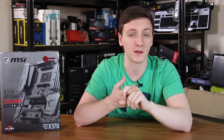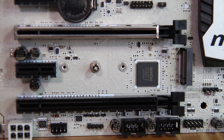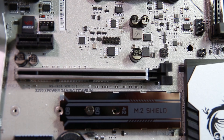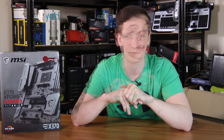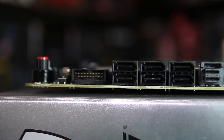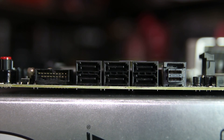You also have reinforced PCIe slots — two that connect directly to the CPU, with the bottom X16-sized slot going through the chipset and therefore not recommended for graphics cards, and not supported in three-way SLI configurations. This board actually has two M.2 slots with a shield on the top one. There's also U.2, which I believe knocks out one of the M.2 slots if not both, so do check the manual for that.